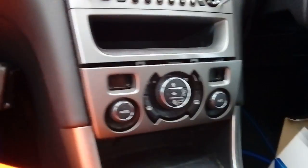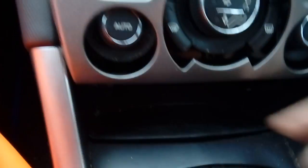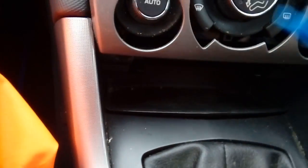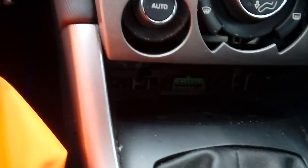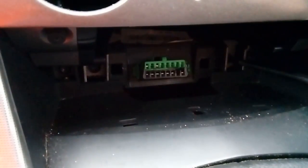At this point you want to put your gear stick back, push the lever down on your ashtray and pull it out. This rubber platform here lifts up — you can sort of pull it away and it comes out completely. Underneath there you can see your diagnostic connector, and there's a TX20 screw here and a TX20 here. I need to remove both those TX20 screws. We've got a TX20 — yes, here we go — so we're going to remove both those screws now.